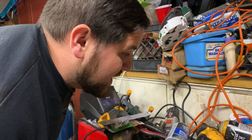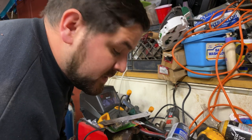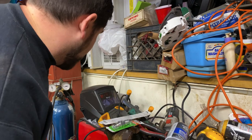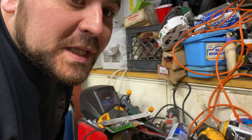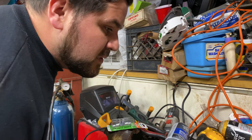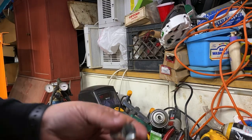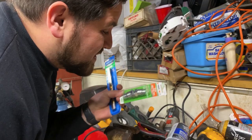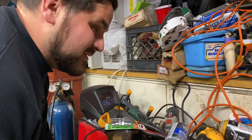I just got everything together and was about to put an O2 sensor in on my foulers, and realized I stripped all the threads out with my step drill bit, which was really stupid of me. So take note when I say use a half-inch drill bit — if you don't have it, don't use your step drill bit. Go buy a new bit, which I just had to go do, because I've got to redo it all again. And that's how it's supposed to look — you still have threads. So continue watching the video, and use a half-inch drill bit.